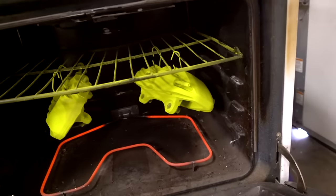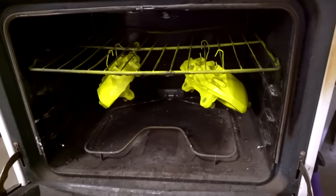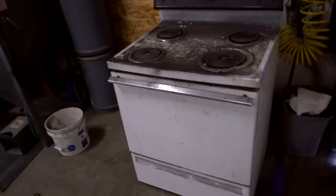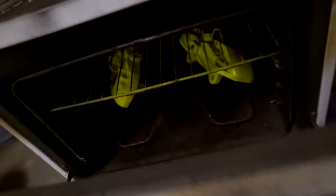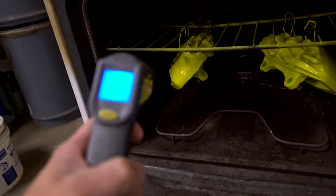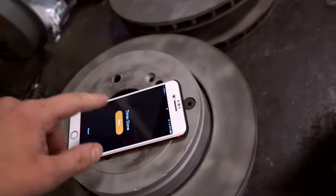They're in the oven. I'm guessing it's going to take about five minutes for them to reach part metal temperature since they're aluminum, so it should be a little faster than steel. As soon as they hit 400 degrees the 12-minute timer starts. We're at 300 degrees so not quite 400 yet. After about three more minutes let's check the temperature again - right now we're at 370. Let's start the timer now; I don't think they're ever going to reach a full 400 degrees. 12 minutes is up - let's pull them out.